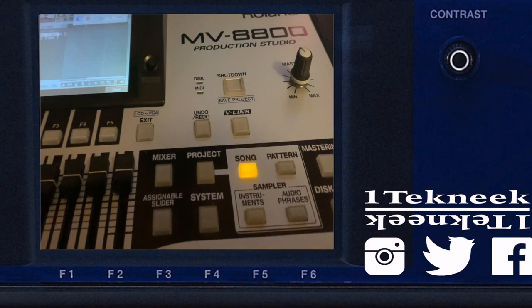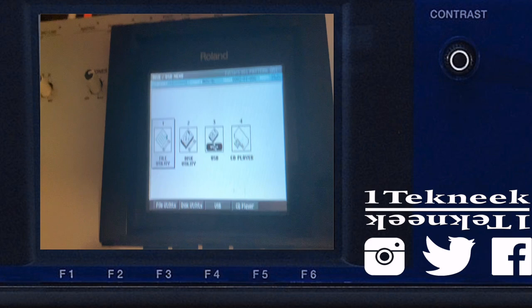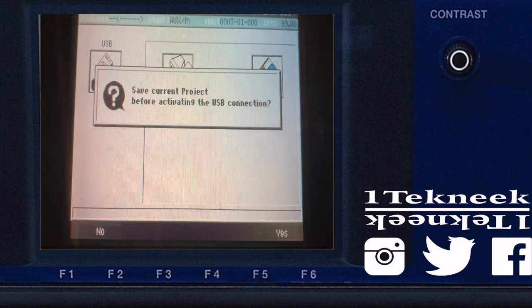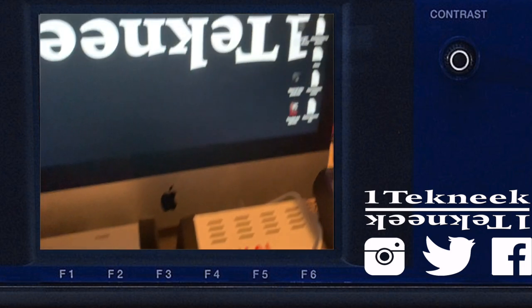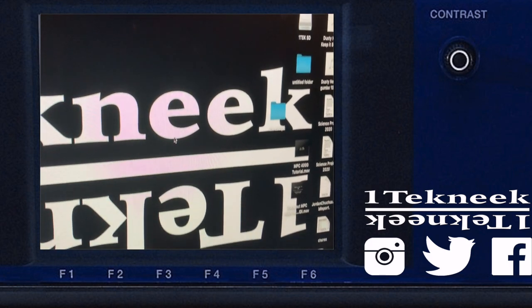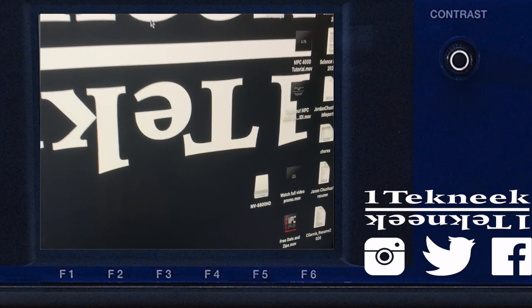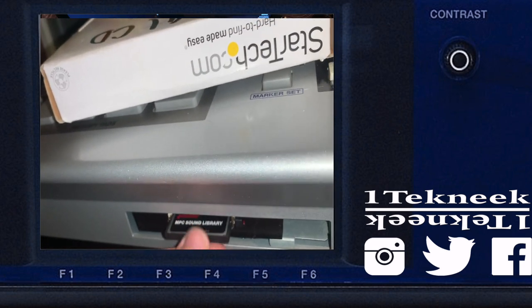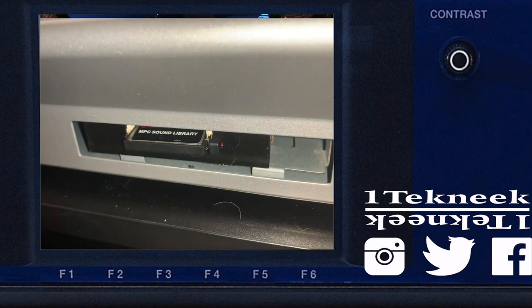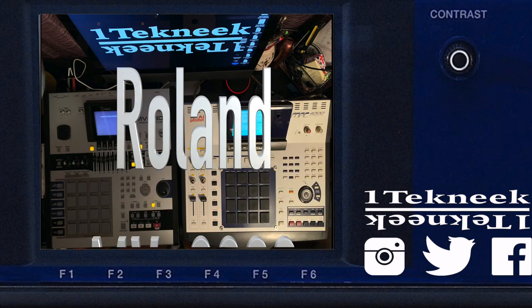With the Roland MV8800, the USB is also on the back, but you're able to read the hard drive and transfer files to the latest Windows and Mac via USB mode — that still works regardless of whether you have an older or newer computer. The only thing is, the hard drives inside this unit are very slow, almost unusable for today's standards. I'd recommend replacing the CD drive with a CF card reader, or buying a CF card reader to SD adapter to transfer files that way. Out of the box, since the Roland is still compatible with today's computers, Roland wins that round.